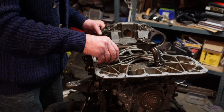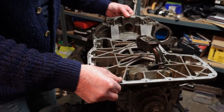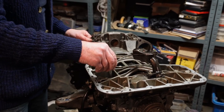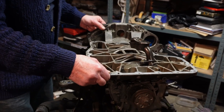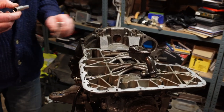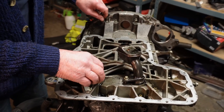These are the last bolts I'm just loosening off completely so we can take the ladder rack off. This really is the most important bit to look at and try to diagnose out of the whole engine, because these catastrophically fail — there's no ifs or buts. They just show no signs and then that's it: mains gone, finished. I've taken three apart. It's a mixture of 10mm bolts along here, then 8mm bolts along the front and back.